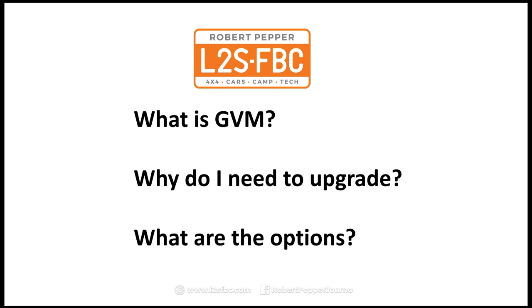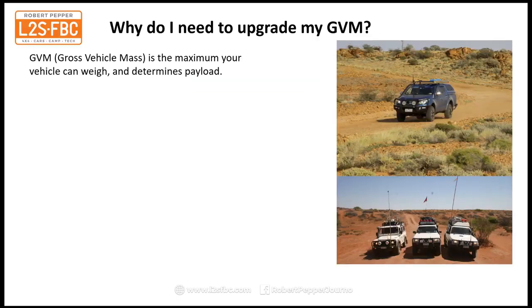Hi everybody, in this video I'm going to talk about what GVM is, why you need to upgrade it, and what the options are. So GVM is the gross vehicle mass, and that is the maximum that your vehicle can weigh. That's important because it determines payload, and payload is the amount and weight of things you can fit to your vehicle so that you can go touring or towing or whatever else you want to do with it.